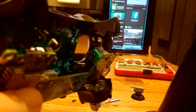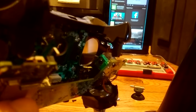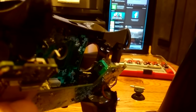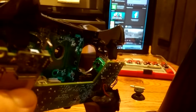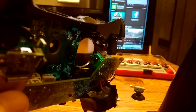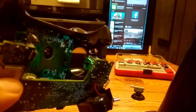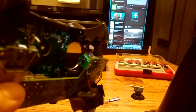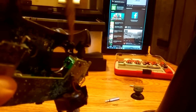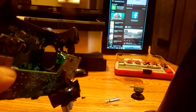Make sure to blow this out with some air duster if you have it available, especially when the controller is disassembled like this — completely clean it out. When putting the controller back, my recommendation is to not add the five screws until you've tested it, since this is trial and error. You might have to do this several times. If you're still drifting forward, turn it counterclockwise a little bit more; if still drifting back, turn it clockwise a little more. This joystick I'm having problems with is drifting up, so I'm going to go ahead and turn that counterclockwise.